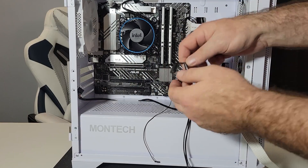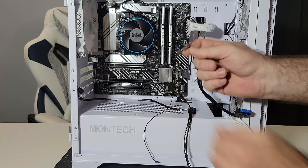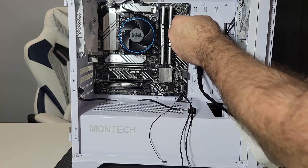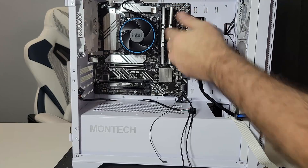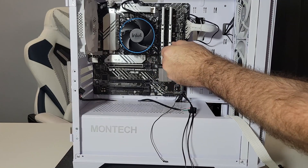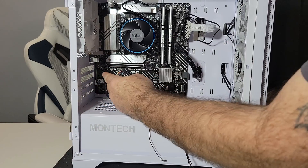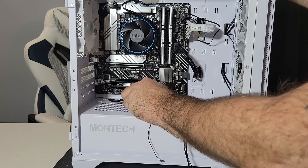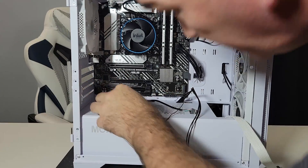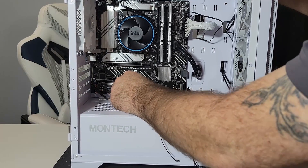Let's start with the ARGB input — this was hanging from the bottom of the hub. We just need to put this to any three-pin header. We've got one up here, two up here, and one down there — it doesn't matter. I'm going to put it up here. Over here we have the audio — HD audio is usually on the bottom left of the motherboard. And USB should be right here. Audio and USB are done.